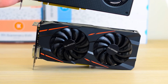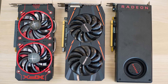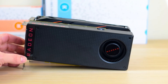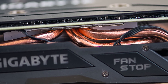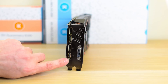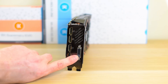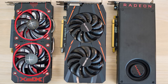It's not overly big — about the same size as the RX 480. There's no real difference in size between the 480 reference model and the 470 G1 Gaming model, although the 470 G1 Gaming model does feel heavier because of the copper and aluminium backplate. With the RX 480 you only have a six-pin connector. On this G1 Gaming 470 model you have HDMI 2.0 for 60Hz 4K, three DisplayPort 1.4 capable outputs, and a legacy DVI port — well equipped with ports.